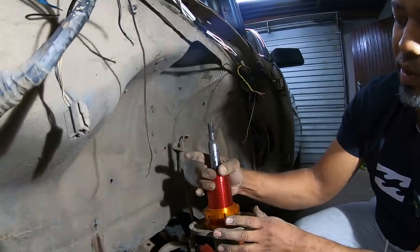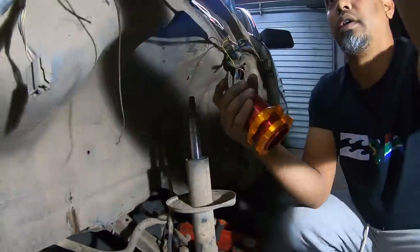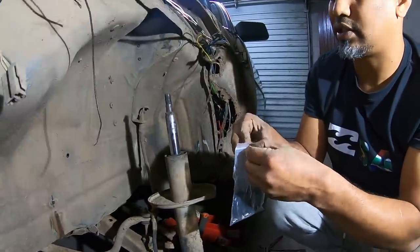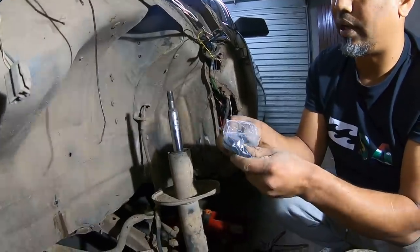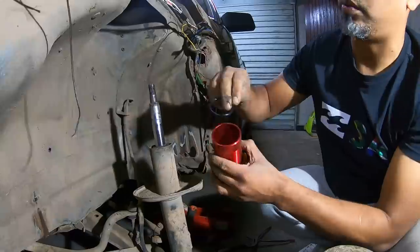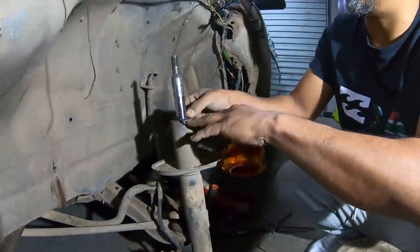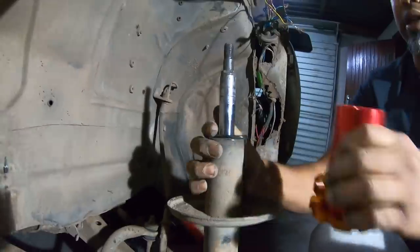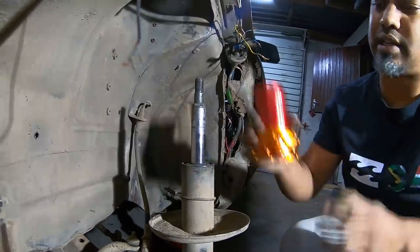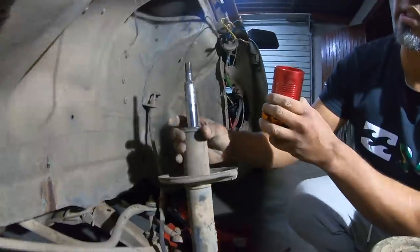Normally we would use the O-rings in between — that's the O-rings for it. In your bag of O-rings, that's why there's different sizes, because obviously you will find shocks being different diameters, and then this would sit in between — over the shock and on the inside of the sleeve-over. Just want to show you guys here. But in this case there is no gap, so the O-ring is pointless.